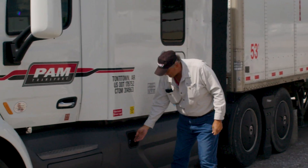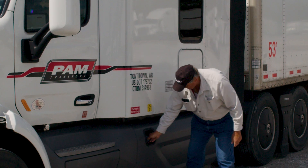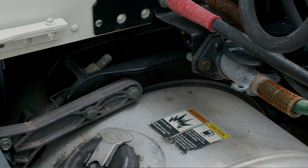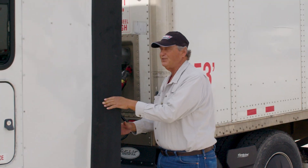We're going to look at the DEF tank lid. Make sure it's tight, comes on and off easily, secures easily, and has the rubber gasket to keep it secured. We'll go back to the fuel tanks. The fuel tanks have straps on them. You want to check to make sure there's no leakage, the tanks are properly secured, and the straps have a rubber gasket to prevent metal-to-metal contact. Metal-to-metal contact will rub a hole into the fuel tank and cause a leak. Make sure the cap's secured — it's got a rubber seal and a chain that keeps the lid on the vehicle.